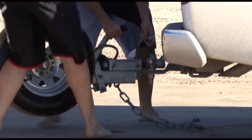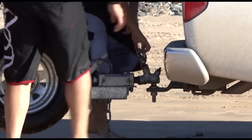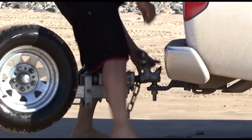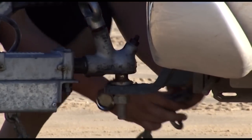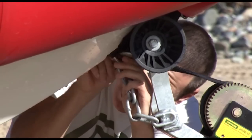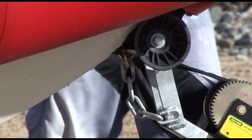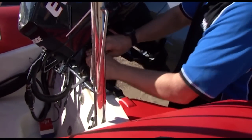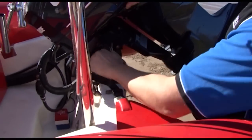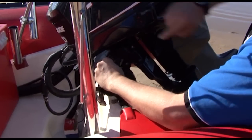Back up and reconnect the boat. If you have a larger boat, you can use your jockey wheel to lift it back up to height to put back onto your tow ball. And of course, don't forget to reconnect your safety chain. Put down the latch on your trailer coupling and put all your safety chains in place on your boat. Trim your engine right up, put your latch down for travelling, and just bring your engine down until it's nice and snug — gives it some support whilst travelling.